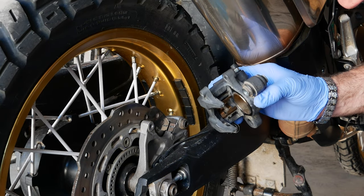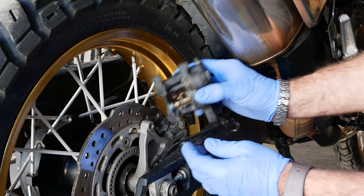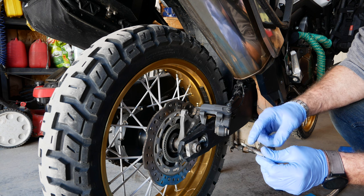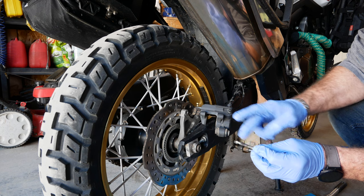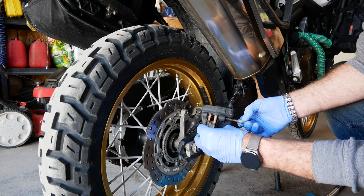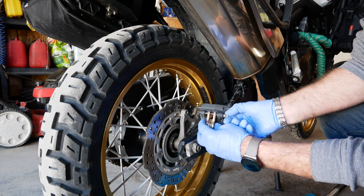As I stated earlier, it has to come in with the wider part facing towards the piston of the brake caliper. That spring is now in place. Now you want to put the brake shoes into the caliper. But first, add a little bit of silicone grease right on that shaft — not too much, just enough to gently coat it. And don't forget those metal plates — they have to be on there as well. Fit through both brake shoes and thread it in; you don't have to tighten it up yet.